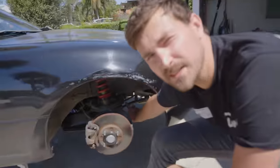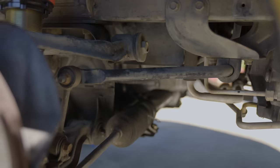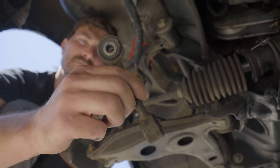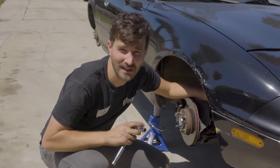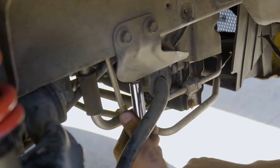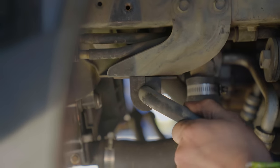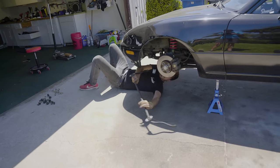We can see our front sway bar in here. The first thing we're gonna need to do to get it out of the car is remove both end links. The end link is what connects the sway bar to the control arm, which is what makes the sway bar work. Without these, you're screwed. These can also get worn out and clunky, so if you hear a clunking when you're going over bumps, it might be your end links. Once you have the end links out, you just need to get the bars out, which is as easy as removing the hardware from the sway bar bracket. That usually attaches somewhere to the chassis — in this case we've got some sway bar mounts. The hardware is really easy to get to. Pull those off and then the sway bar should come free.